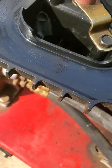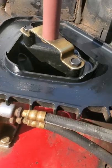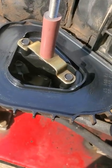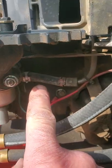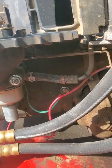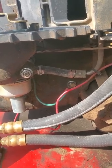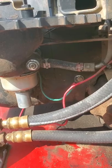If you can see that butterfly valve down there for the choke — the choke does seem to be closing all the way. But when it's cold, man, it just won't crank up. Put a little starter fluid in there and it cranks right up when it's cold, but without that starter fluid it won't do it. I took off the fuel pump hose to make sure it was squirting out real good — it comes out fine. I read something about making sure the fuel pump was priming properly, but I'm not sure what that means. Any tips would be appreciated — thank you.